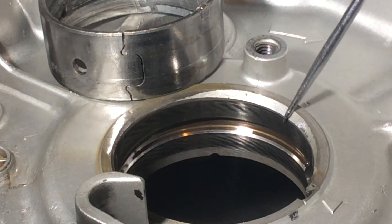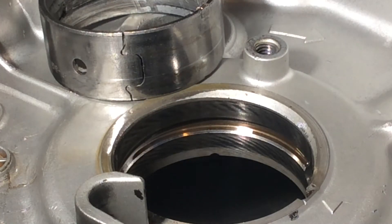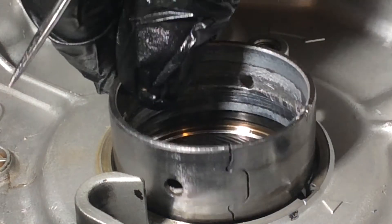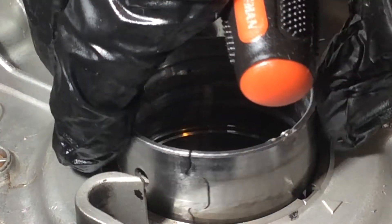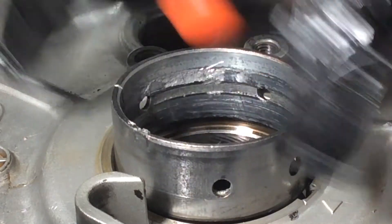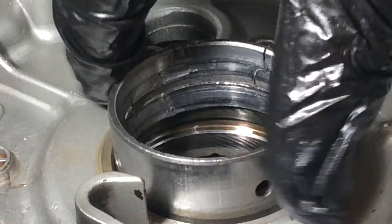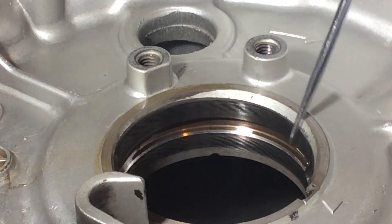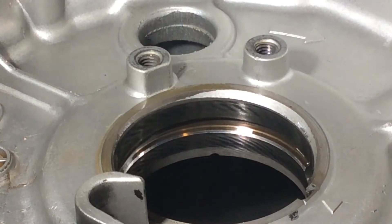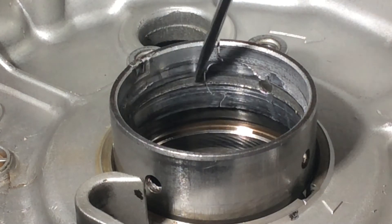This aperture here is chamfered — it's not chamfered all the way around. When I took this engine apart, this bearing had spun. So I think that little lock tab — I've obviously bashed it back in — but it would have been sticking out as it spun round, because that's the clockwise direction of rotation of this engine, as given away by that arrow. And I think that little tab has basically gone all the way around and then started cutting into the material there. There's absolutely nothing else that would have taken that out apart from that tab, and then that material has ended up inside here, which is where I dug it all out.